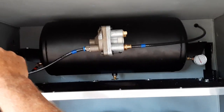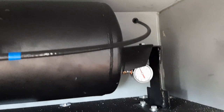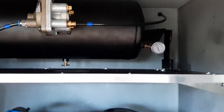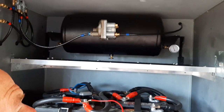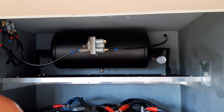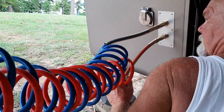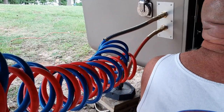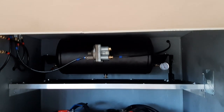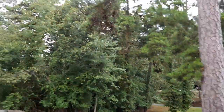And then it goes through this valve, which is your braking valve — it powers this valve. And then this line here is what actually goes back to the brake canister, hooked to the master cylinder, which pushes the hydraulic fluid into the calipers on the brakes. So that tank is strictly for emergency? More or less, yep. And otherwise it's getting air from the truck. When the brakes are applied, the air comes down this blue line — and this charges the tank, the red line, for emergencies. If either one of those breaks off, that tank will take over and apply air automatically to stop your RV from rolling away.